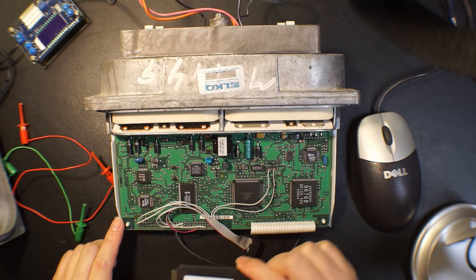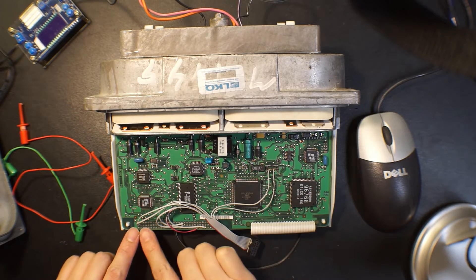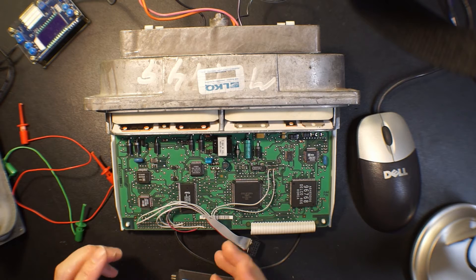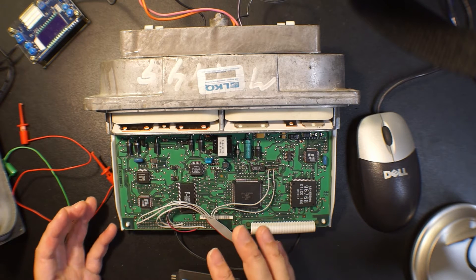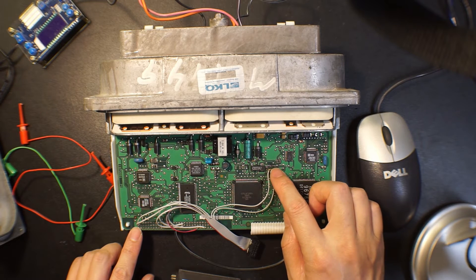To access it you need to use USB-BDMNT. The pin out on the bottom here is almost identical to the ECU411, but flipped. The picture on the 411 is this side, but the DSO and DSI pins are here.